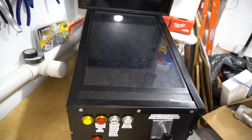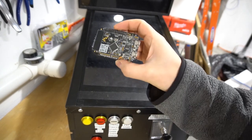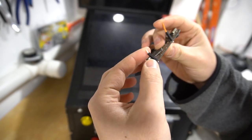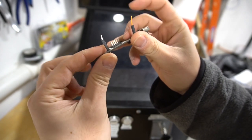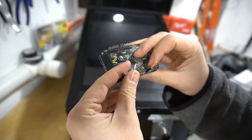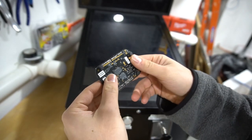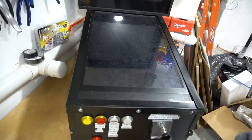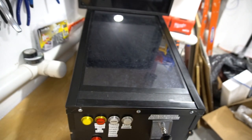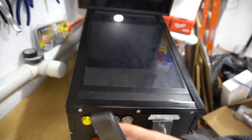All right, guys, so we swapped out the RAM sticks on this. We got the new KLZ board running. So basically, again, this was the old one. I'm not too sure if Kevin did this right here, but this was basically just randomly put here. I'm not sure who did that. I do think that's what shorted out this board. So this is totally fried. Again, this was running 4 gigs of RAM, swapped out and put in 4x4. So this is 16 gigs of RAM running on this.